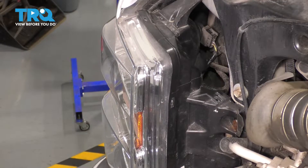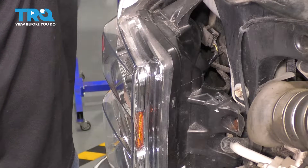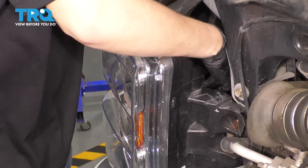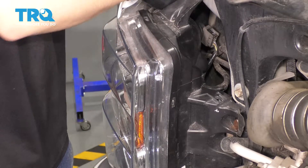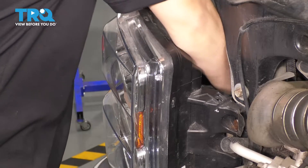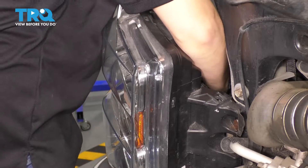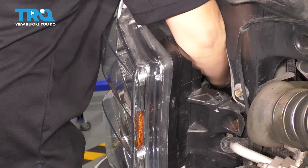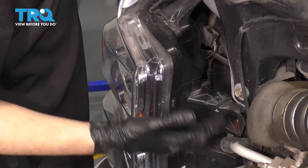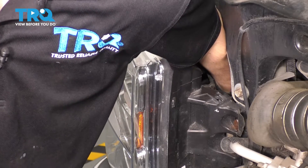You won't really see what I'm doing here just because the bulb is all the way behind the headlight. I can't even see what I'm doing, so it'll have to all be done by feel. You can reach in here and you'll see this socket at the top — go underneath it, straight down. You'll feel another connector with a socket, which is approximately at this height because that's where the headlight bulb is and that's what we're after. So what you're going to have to do is turn the whole connector counterclockwise if you're looking from the back, clockwise if you're looking from the front. There should be two little ear tabs on it that you can grab onto.